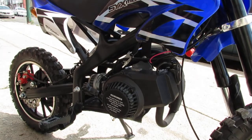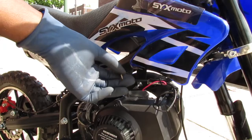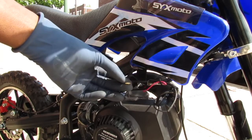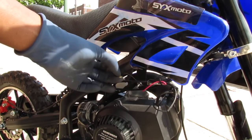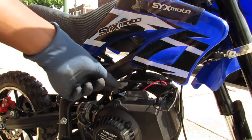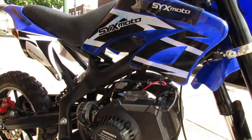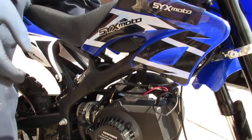I don't know if that kill switch is a problem. I disconnected the kill wire from the chassis and put a little bit of fuel into the spark plug cylinder. Let's see if it will actually start. It should, because it grounds out to the chassis and that kills spark. So here we go.